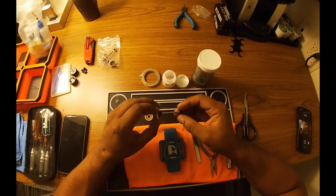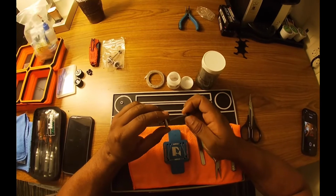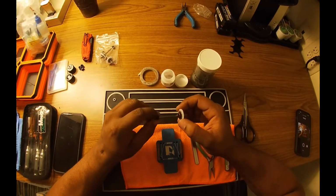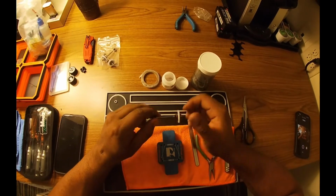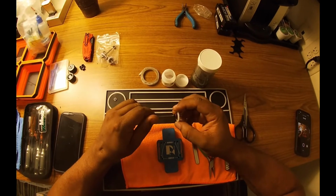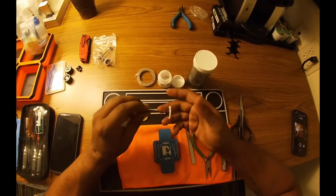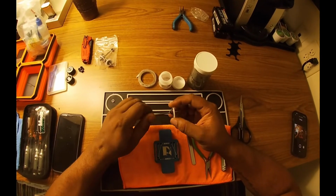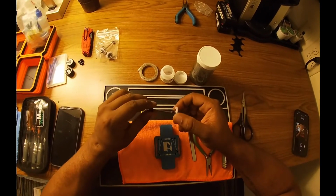To tear it apart, do the exact same steps, but the opposite way. Back off the nut as much as I can without it falling apart, then push everything down, take the C-clip off, and dump everything out. Do the same process for how to tape tires, like I showed you in other videos. And that's really it. Not super complicated or anything like that.